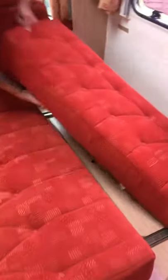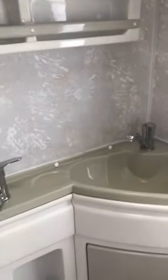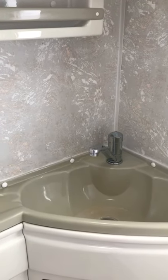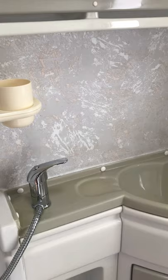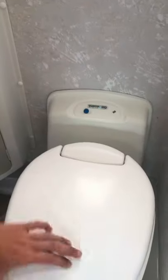Under here, located down in there, is your drain valve — that'll drain your tank and your boiler. When it comes to winterization, make sure you have this tap open, then go into the kitchen and open the tap between hot and cold, and then go into the bathroom. Make sure you open the shower and the sink tap both between the hot and cold position — it stops any air block. In the bathroom, that button does your toilet pump, and underneath just here is your little lever that simply twists and opens up underneath.